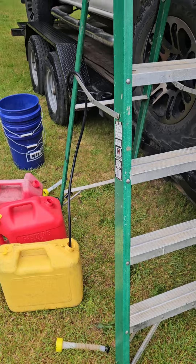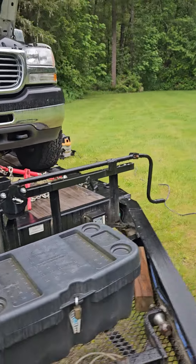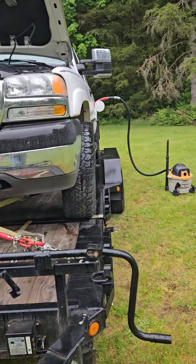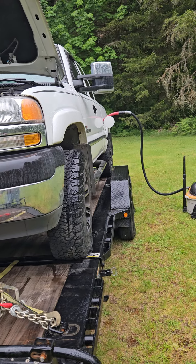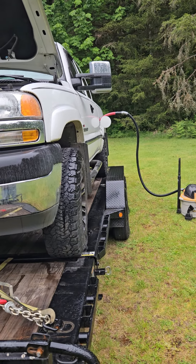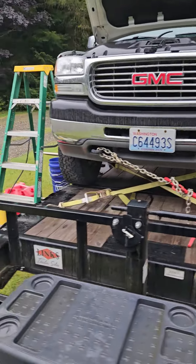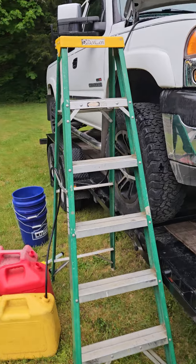With the pickup tube being way at the bottom of the tank, I should get almost all the gas out of there. Then I'll put in some diesel and do the same thing to get all the gas out of the lines — this way I'm flushing everything out. I think it'll work; it seems to be working. But if I blow up, I love you Dave.